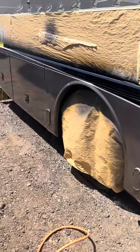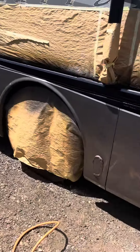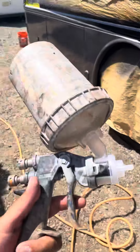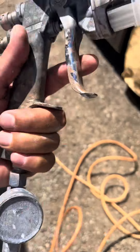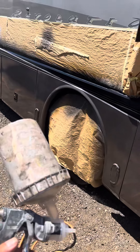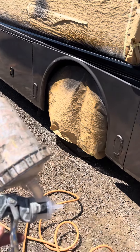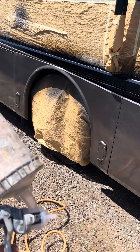So many people are interested in my video about how to spray outside — how do you leave it so clean, how come you don't get dust on the vehicle? I mentioned there are a couple other things I have to cover, so I'll go over it again. First of all, my pressure is set at 20 PSI. I usually do go a little higher, but 20 PSI, maybe lower, when I first mix the clear coat.